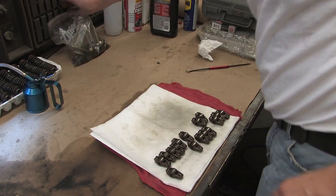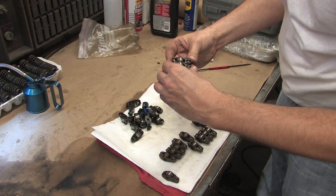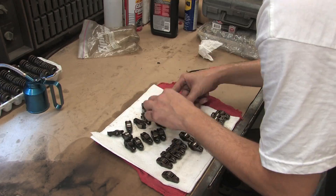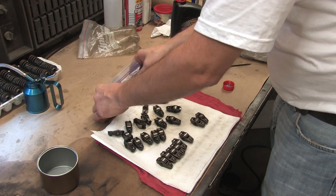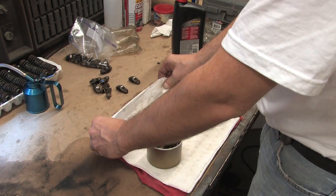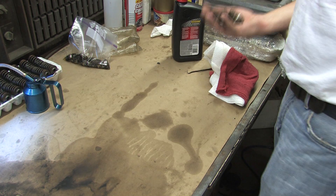Separate the wheat from the chaff and soak your good rockers in clean oil to prevent them from rusting prior to installing them. I've got 8 good rockers and 8 bad ones — I need a half a set, which would be 150 bucks plus shipping. But I pulled a whole set out of a non-turbo 1G in a junkyard a few years ago for 16 bucks. You can pull them without removing the cams, and you can use any 4G63 or 6G72 rocker arm because they're all the same part — 1G, 2G, Chrysler, New Yorker, it doesn't matter. There's a list of cars that came with a 24-valve 6G72 engine linked in the description, which may be more prevalent in your local junkyard than a 4G63. I won't be reusing any of this set on the GSX, but I'm keeping these 8 just in case. The next time I'm in the junkyard I'll scout for a new set of spares. It's better than buying new ones when you can get all 16 for less than the cost of one, and as long as you know what to look for, you can avoid introducing unfavorably worn parts to your valve train.